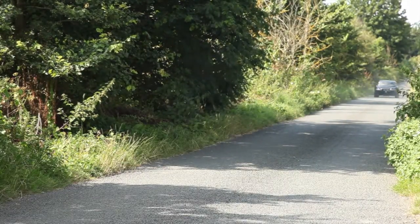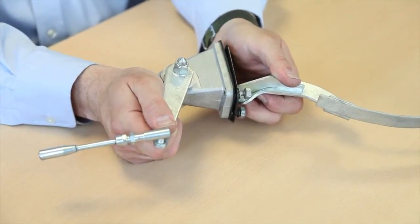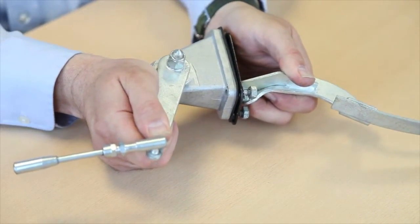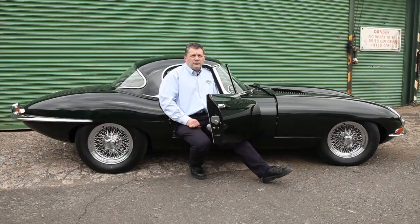The original six-cylinder E-Type throttle pedal and rod linkage suffers with three main areas of lost motion. The end of the accelerator pedal can travel as much as 20mm before engaging with the linkage lever. The pedal and linkage levers rotate on a 5/16th of an inch pin which has a biased action and quickly induces further wear.